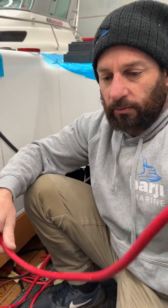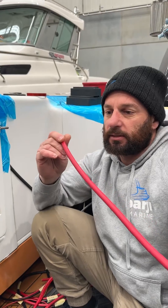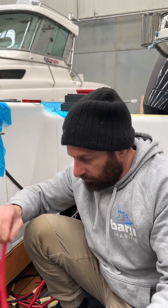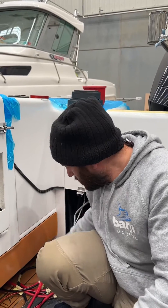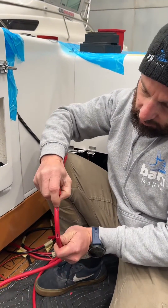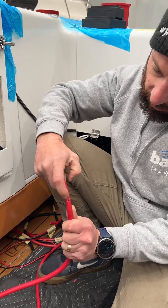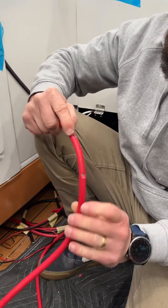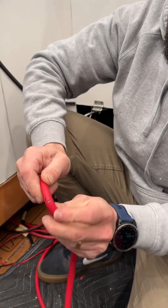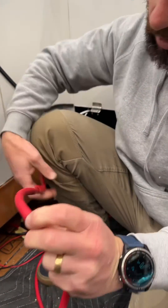It's gone black. Now we've stripped back nearly probably six, seven hundred mil and it's still black here. So we thought, goodness me, how far has that gone? We've pulled this through and just started doing a bit of a test — you can see we start stripping here, still black, still black and corroded, and we're starting to pick up some clean wire here, and then eventually back down there we found clean tinned wire.